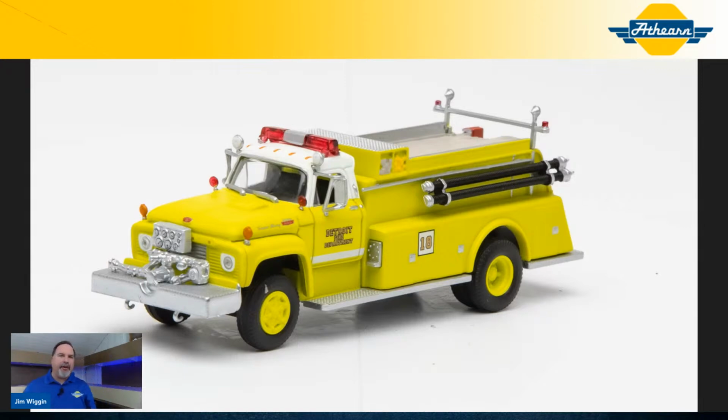Now, some interesting things about this truck. To streamline production costs, medium duty trucks and bus chassis retained the cab and hood of light-duty trucks. Also, in place of the twin I-beam suspension, a solid axle in the front was retained. Also, they redesigned the front fenders to accommodate a wider front track and also larger wheels. And the front fascia was derived largely from the 4th generation heavy-duty F-Series, adopting a full-width grille between the headlamps.